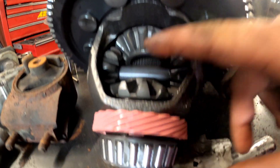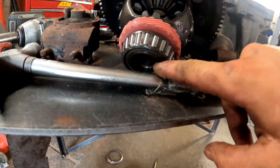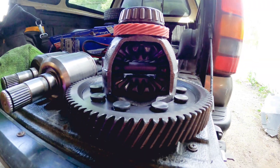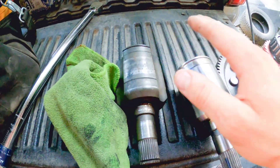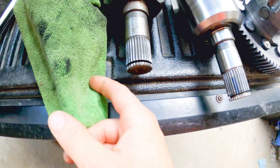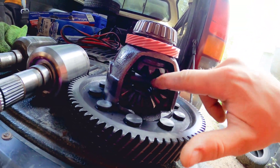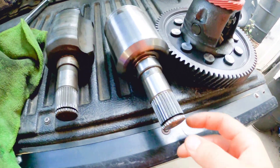What I'm going to do is shove axles in the ends to make sure everything's in line and then weld her up. I removed two axles that I broke and just took the shafts out, so now all I have is the splines, which is exactly what I need because that's going to align the actual spider gears. They can move in there, so it's important you do that or it won't work.